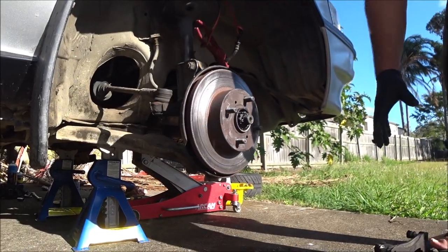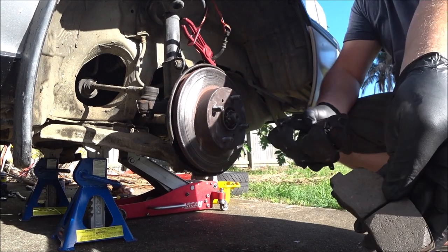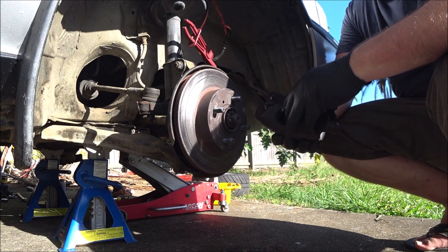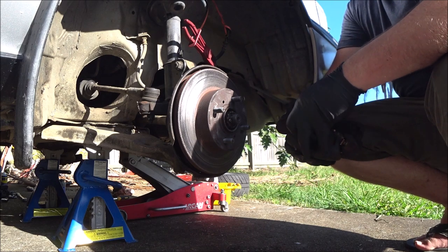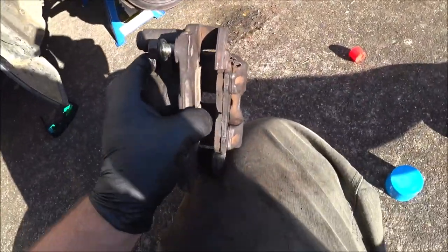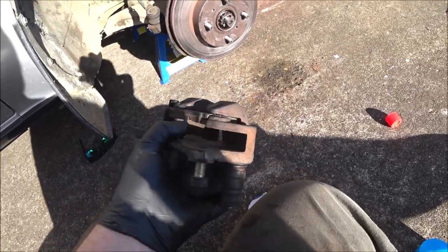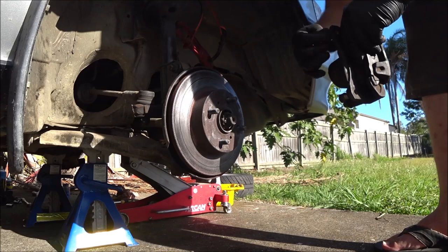Down the home stretch. Let's pop our pads back in our caliper, clean, wearing gloves. These particular pads don't seem to have an inside and an outside, there's no wear indicator. So like a lot of things car related, it's much easier to do when you don't have to find a camera angle to film it. So pads are in, this will slip straight on. Take your bolts out.